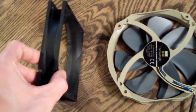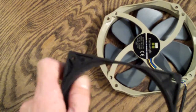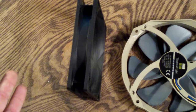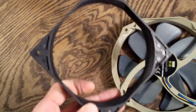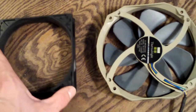That's pretty much how a fan shroud works — it's pretty simple. You can make these yourself: just get some cheap case fans, cut the middle out, sand them down, and you're good to go. You can also use different thicknesses — the thicker it is, the better it's going to work, same as with fans. This is a 25mm thick fan and it'll work perfectly fine. If there's anything else you guys are wondering, just let me know — leave a comment.